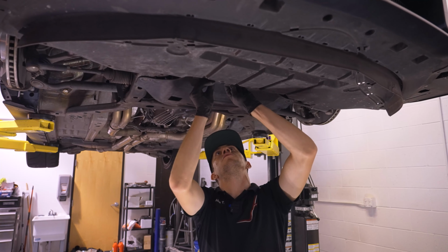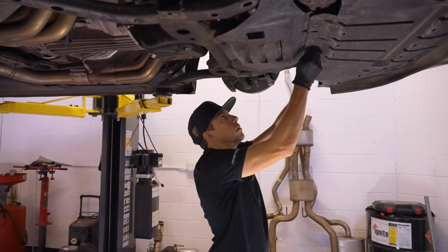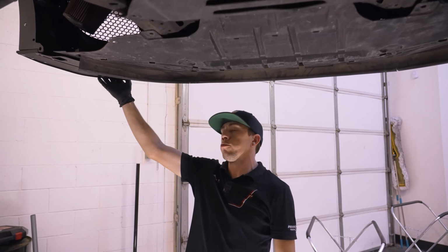And then we'll get all the rest of our bolts and make our way around the under tray, getting everything connected. One note I'd like to make, the under tray is absolutely not optional. It provides a lot of the strength that the bumper needs, especially at the bottom. And then you're adding more or less real aero to the car with these canards on the side. So if you don't have these, the bumper will fold under when you drive on the freeway.